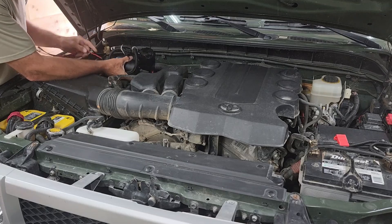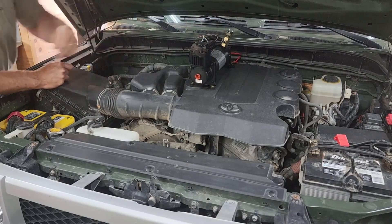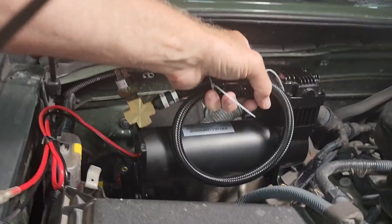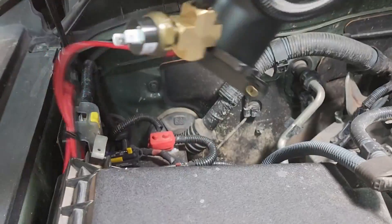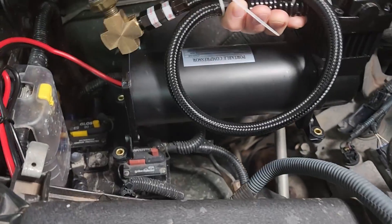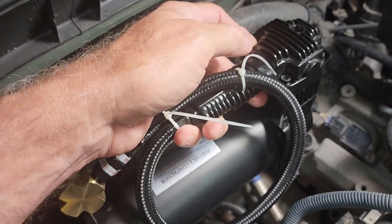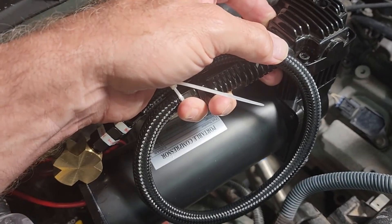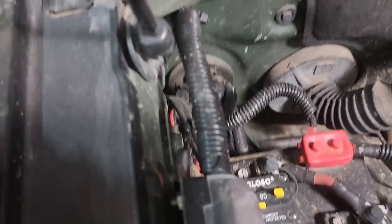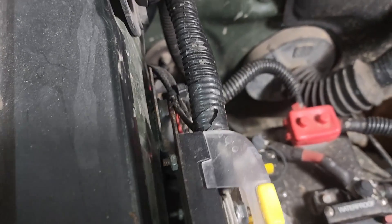The place I've got in mind is somewhere in this area. I'm going to have to fabricate a bracket. Let me show you what I'm actually looking at underneath here. Depending on where I can get the bracket aligned, I can either put it on its side or have it standing up. That'll be too tight that way, so it's going to go in a side-to-side orientation, and it'll certainly be low enough to miss the hood. If I do the bracket right, I can still get to my fuses underneath to reset them if needed. So what I need to do is work out my connection points where I can attach a bracket, and that will kind of determine the shape the bracket takes.